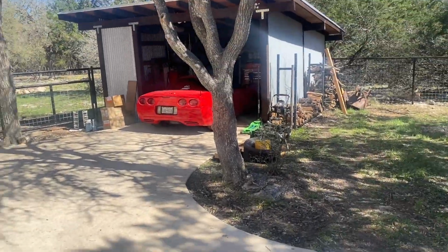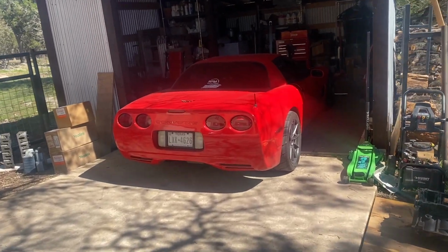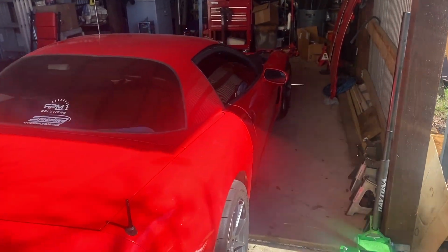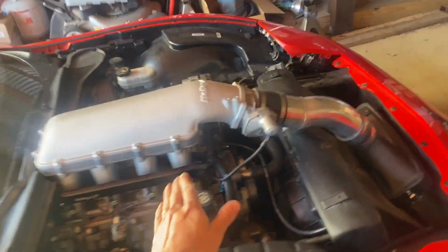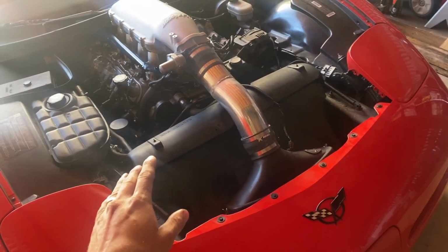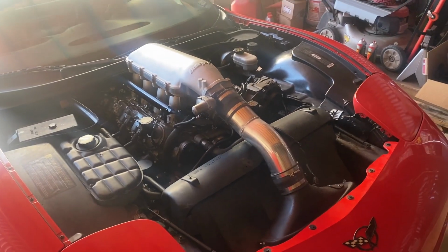So because everything looks so good on the engine, I'm going to chassis dyno the car later this afternoon at Josh's shop, Lunatic Garage. We're also going to do some testing where we'll find out how much power, dial in the tune-up perfectly, find out what timing it needs, what air-fuel ratio it needs. Then I'm going to pull the filter out, see how much power it makes. I also have a really nice bell mouth throttle body that we'll put on, delete this pipe, bypass this, and see how much power that makes, and potentially run just that at the Texas Mile, because it's on an airport runway, and for a race car, you don't really need a filter while you're racing, at least.